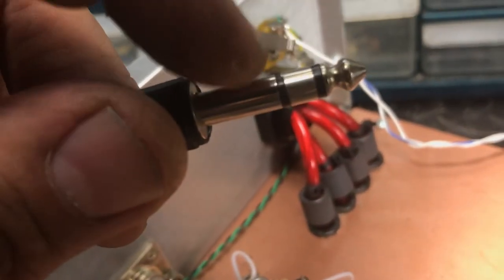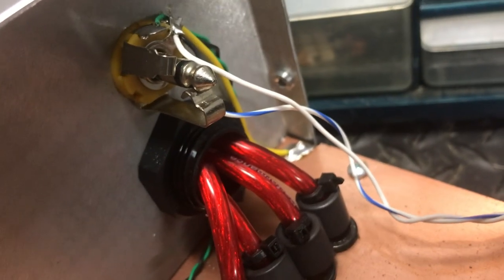You do not plug this in with your hot wire hooked up. You always unhook DC power from your amp before you plug in your remote. Let me tell you why — on your tip, this is ground when it comes in. It's going to short for a split second. If you push it in slow and your stuff tries to kick on, it's because it's shorting right there when it first comes in. The caps are loaded now — watch the fans — when you come in with this slowly, for a split second it shorts the ground.